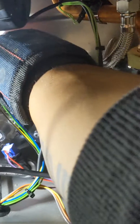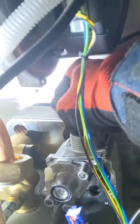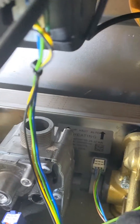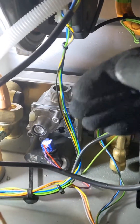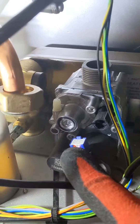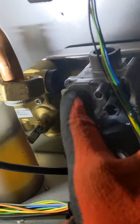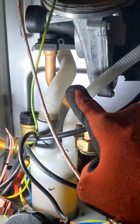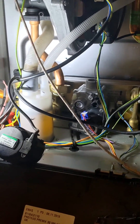Turn it down and it just sits back in place. You'll need two hands because it needs to line up — pop it in. You've got your two 4mm allen key screws, get those tight, put the gas connection back on, put the silencer back on, and then retest it.